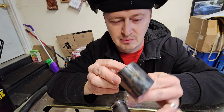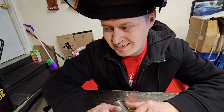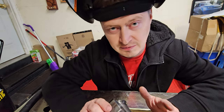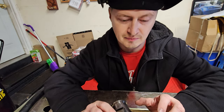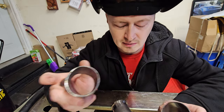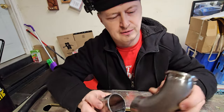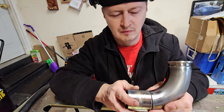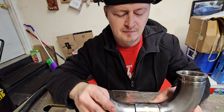It's not bad. I would actually approve of this one, but what I'm using at home is a lift TIG, and I absolutely hate lift TIG. I cannot get it to light up nice enough to weld this, and it seems that this particular steel melts really, really quickly. But basically the idea is to weld this pipe to this one right here, and our exit pipe like that.